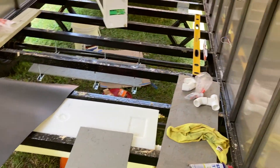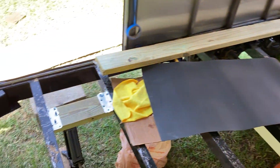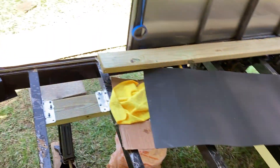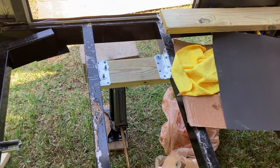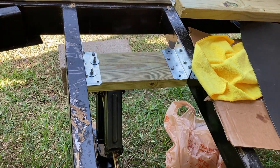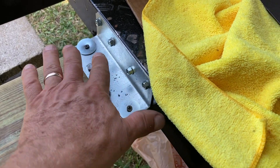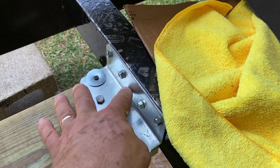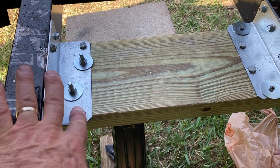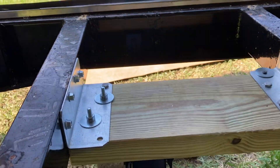That gives 40 gallons for fresh water. You can see there are jacks mounted here to accommodate leveling of the trailer. The main stabilizing bolts come up through a treated two-by-six and then have these very massive brackets that are screwed in well. One side of the stabilizer is bolted straight through the metal bracing — I'm going to show you the underside of that.